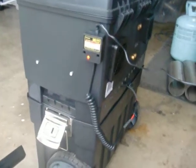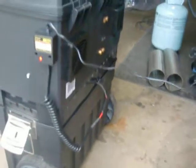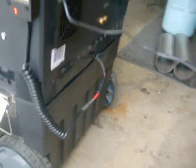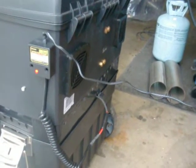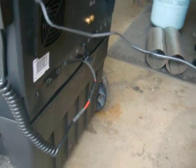On the side I installed a charge controller — a trickle charger — and it basically just trickle charges the battery. I put it on a little quick disconnect so I can unplug it, because if you unplug it from the wall that LED will stay on and drain the battery. Put one of those on yours so you don't have a problem with your battery going dead.